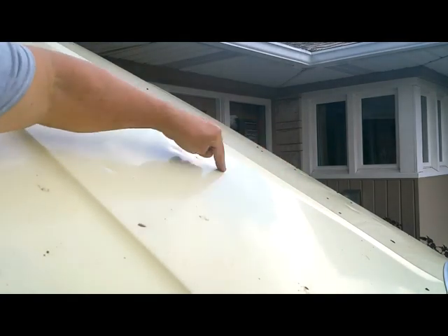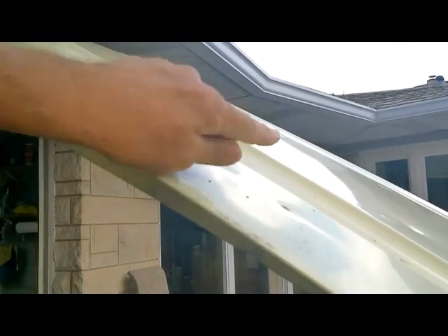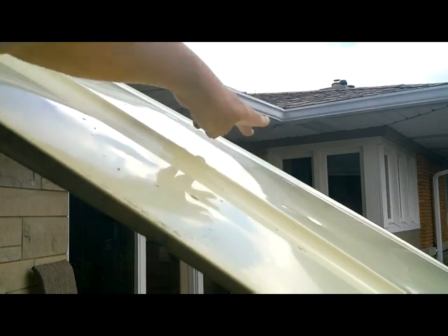I don't know if you can look down through there and see these dents, but this thing's got hail damage everywhere. And the ribs of this hood are in the way on some of them, but this one right here I can get to. So I'm going to take my hand tool here and we're just going to work that like that. I'm looking down across it this way and I can see it. That's pretty good there — a lot better than it was. We'll never get them all out probably. Let's see if we can reach some of these up here.